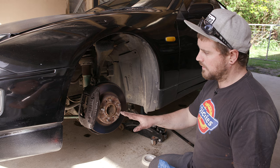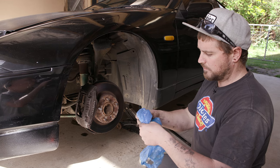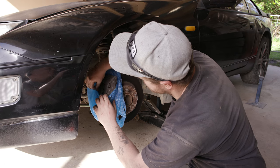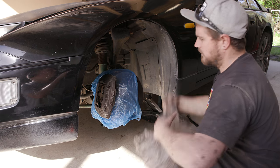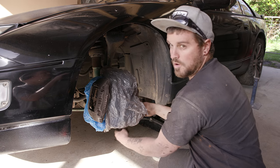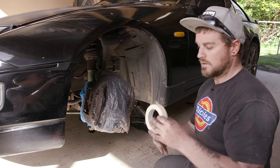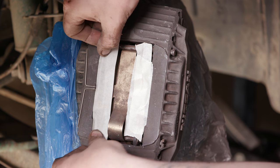There's a bit of a trick — rather than using masking paper or newspaper, what you can do is just tear a little bit of a hole in a plastic bag, just a small hole, and start to thread that over the top of your brakes. Just increase the hole size as you get over the top, and like that it fits pretty good. Use another plastic bag — these are just the ones you get from the supermarket that you're going to throw out anyway. And just like that, your whole brake is masked up. We'll use some masking tape on top just to stop paint getting inside the pads.